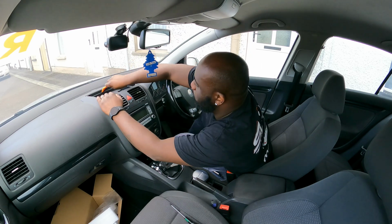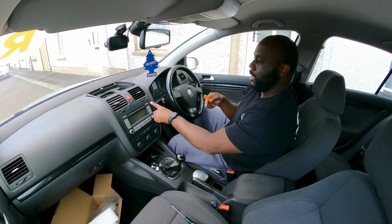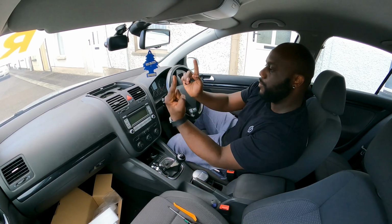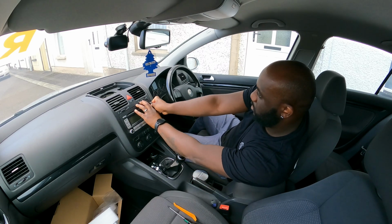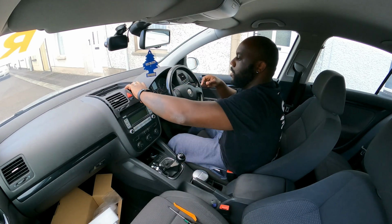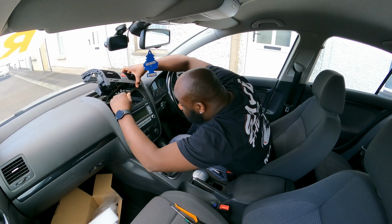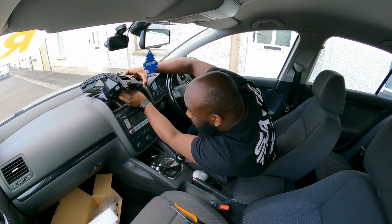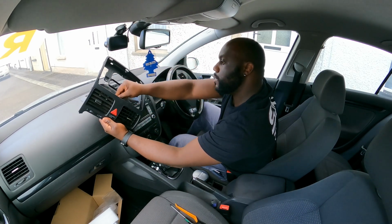And now to remove this, you can pry this off from the back. You can see the tabs. Yeah. And now here at the front, they actually clip on the bottom trim. So you'll have to pop them up first before you actually take this off. There. And again, careful with that plug. And there's something else connected here. Yeah, for the light and the hazard. So there's a plug here. So that's one off, and the other one comes out from the top.